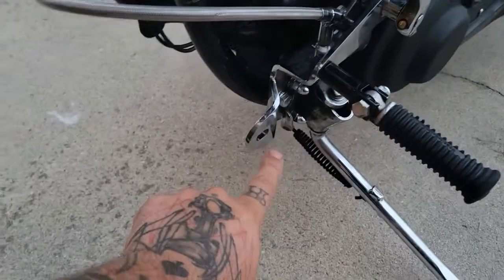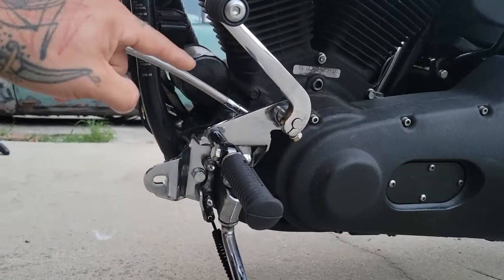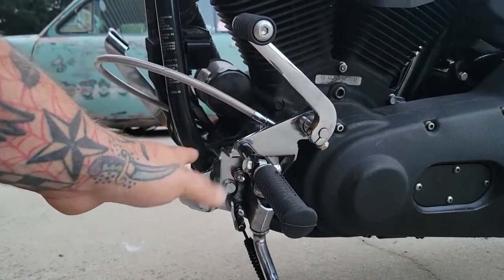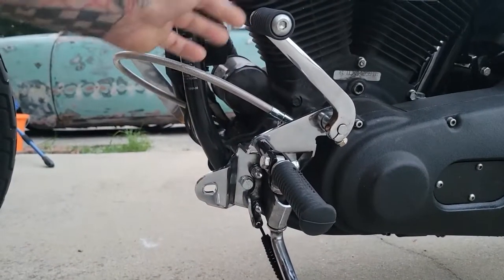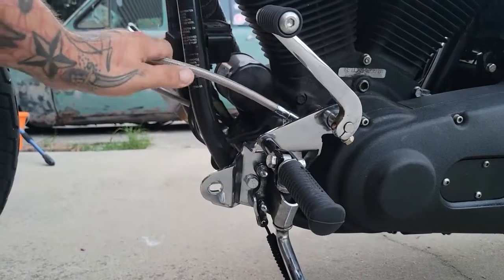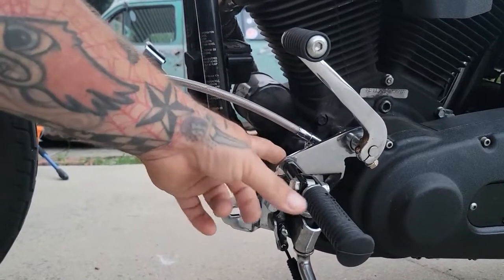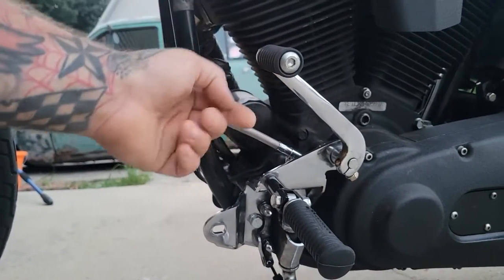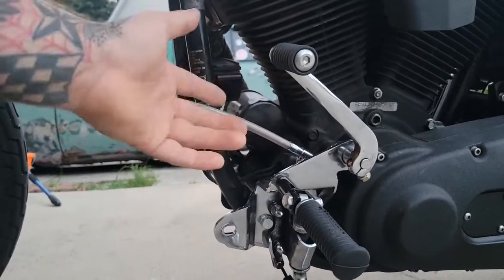We had to make some modifications. They want you to mount the foot peg down here, but if you take a step back and look at it — your lever's here — putting your foot peg all the way there puts your foot not only two inches further forward than your right-hand side, but also two inches down, which makes it really awkward. The bracket bolted up correctly, the cable is great, the linkage and mechanism are all fine. But I had to buy a peg mount, drill a hole, take the factory peg, and mount it up here — it actually worked out perfect. I just have to modify this arm a little bit to move it out so it works better.